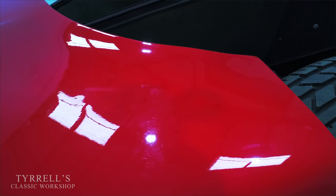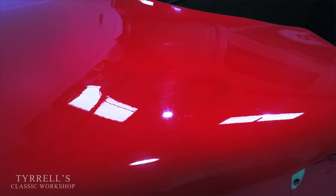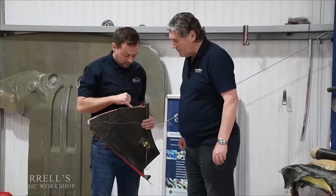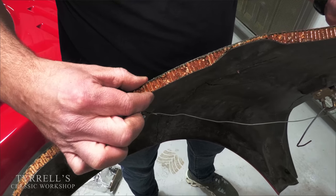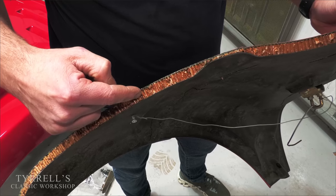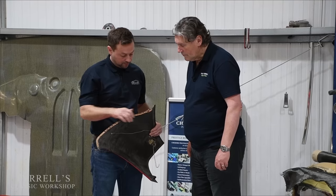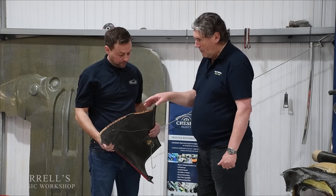Now, can you explain again using your trusty bit of Ferrari F40 wing? So we've got this. Did you say this was aluminium? Yes, this is aluminium honeycomb. We've got a carbon Kevlar layer at the back, very thin, then an aluminium honeycomb sandwich, and then carbon Kevlar on top. So when the bumps appear...